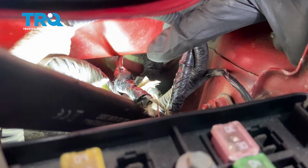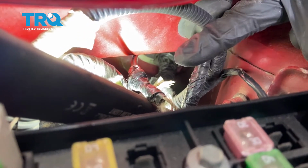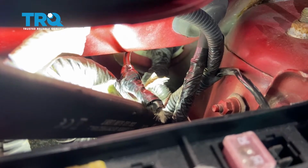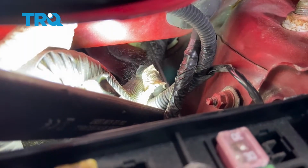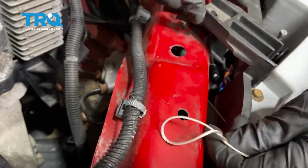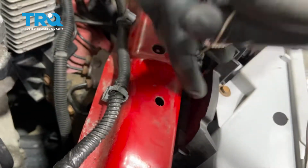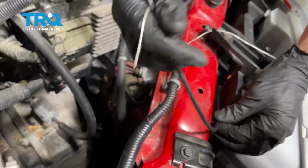All right, so as you can tell, this cable's coming through perfectly. Now, when it gets to the point that the rubber grommet starts wanting to go through the firewall, it's important to keep tugging and make sure it's completely seated. Just go ahead and give this a little tug. Okay, I'm starting to see it coming through here. Make sure I don't get too caught. All right, this is looking good at this point.